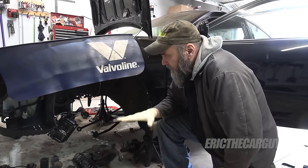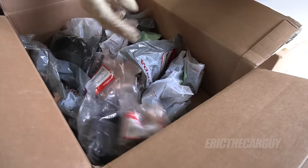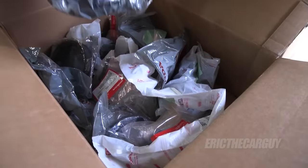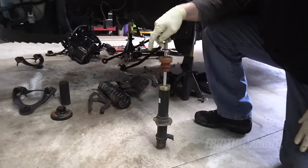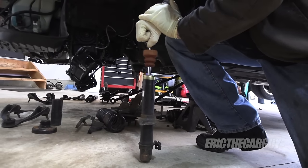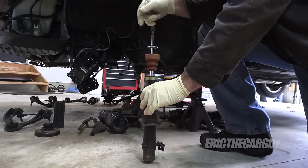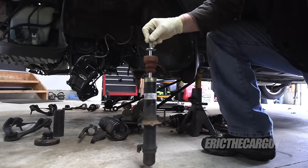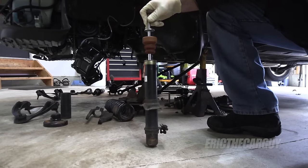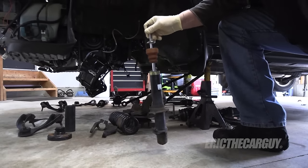My restoration has continued onto the suspension. I purchased a bunch of original equipment bushings and things for this front suspension, as many parts as I possibly could that were original equipment. I also saved things like these struts — these are unobtainium, specific to the Type R; they only work on the Type R. They're not leaking, and as you can see, I can compress it and it moves slowly. If it does this, the strut is still good. I'm going to recondition this, clean it up, and paint it to make it look like new, despite the fact that it's got about 150,000 miles on it.